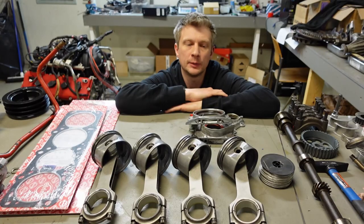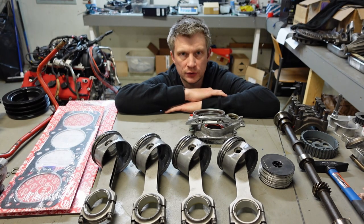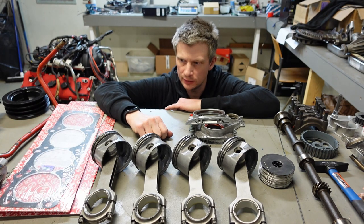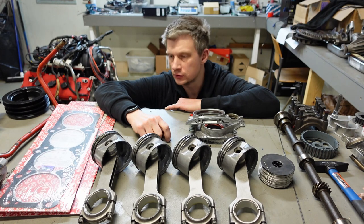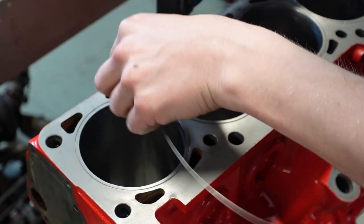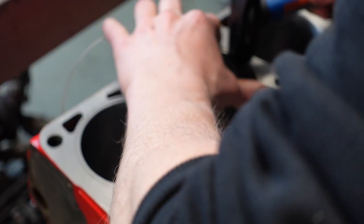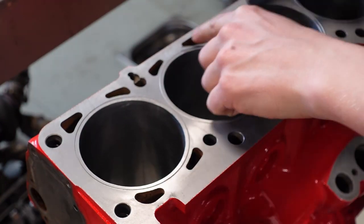Update in the middle of the episode - it's been a while since I last recorded. I left off assembling one piston with the rod and have since completed the rest of them. Now it's time to insert the stainless steel wire into the O-ring grooves machined around the cylinders. You just tap the wire into place, and if it won't stay you can use some CA glue.